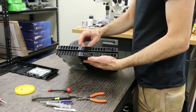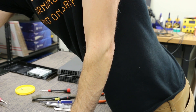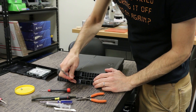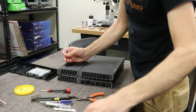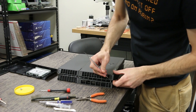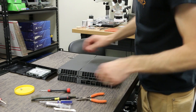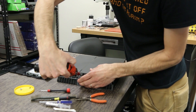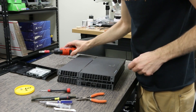The next thing we're going to do is take the stickers off — the warranty stickers — and also these screw covers right here. You'll need a pick to get those off, though you can also use a flathead screwdriver. I usually use a pick because it's easier. We just put the pick in and they pull off like that, revealing two more screws. We're going to take those screws off as well behind the stickers. None of these stickers have to go back on if you don't want them to — they just cover the screws, and the middle two are warranty stickers. In the interest of saving time I'm going to use my electric screwdriver for these screws. I don't recommend using an electric screwdriver unless you have a lot of experience, because you don't want to get them cross-threaded.